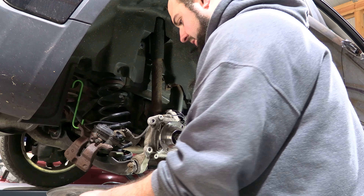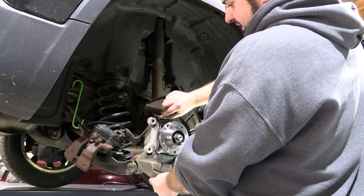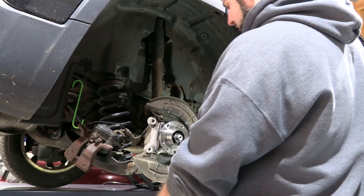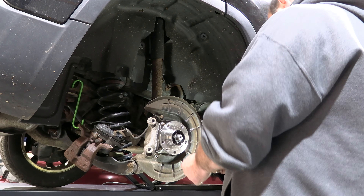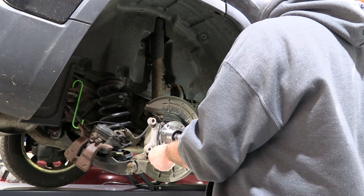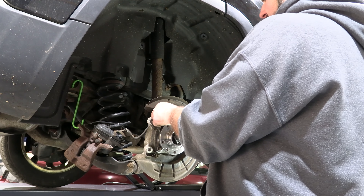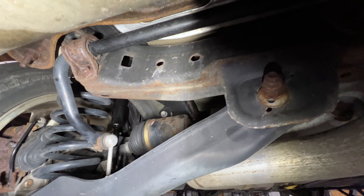This went a little easier than I expected. Like I said, I've had everything on this side apart, aside from the four hub bolts and the hub itself. These bolts need to be torqued to 70 foot-pounds according to the service manual — not really super tight. I got the hub tightened down to 70 foot-pounds per each of the four bolts. Now I'm going to put the dust shield back on using the 10 millimeter bolts, and then we'll put the rotor back on and the caliper.